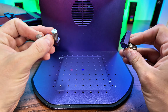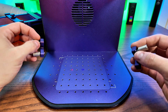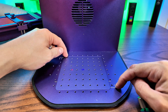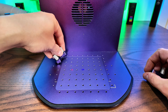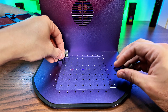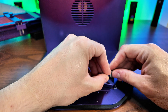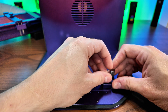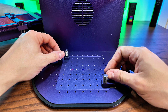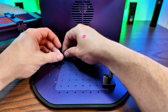Now there are plenty of in-depth tutorials out there but I'm going to run you through this. You get these two little L brackets — we want to be getting started with these. On your build plate you've got two little right-angled white lines. The first thing we're going to do is take those L brackets and screw them into place so they line up with it, and this is going to give us our platform to mount our extension rail onto. I'm just going to quickly do this live on camera. There we go, that's the first stage done.